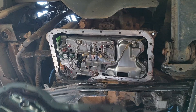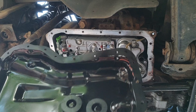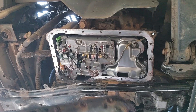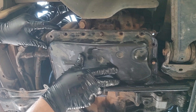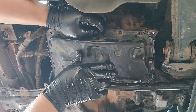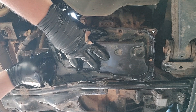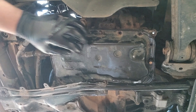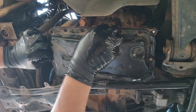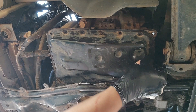Got the pan all cleaned out — looks great. Bolts are in place holding the gasket, which is nice because it holds it in place for you. We're going to fish the pan back around the same way we took it out, get these started by hand. Just kind of do the wiggle and jiggle a little bit — you can feel it go right into the threads of the housing. Next up we're just going to put all the pan bolts back in and torque them down.